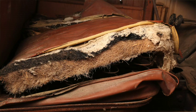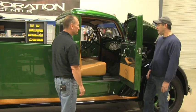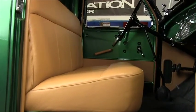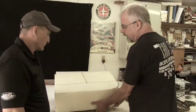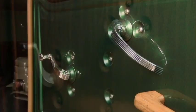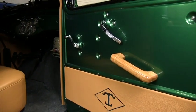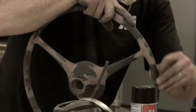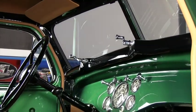When we first got the truck, the interior was a total mess. First we got all the rats out — it was a big rat's nest. The seat springs were just too far gone, so we used high density foam to replicate that. The seat back is original but the base is all foam. Bob Kussman did all the interior work; I really like what he did with the panels with the Diamond T logo. The interior was really basic from the start, so we wanted to spice it up. We added Italian leather and kick panels, went through probably 30 hours of labor just restoring that steering wheel, and we were able to take the original heater, restore it, and it's all functional.